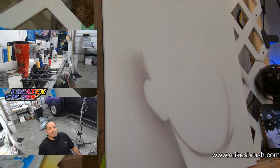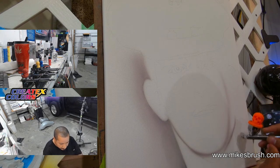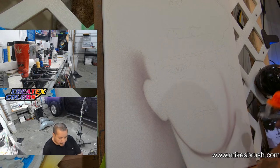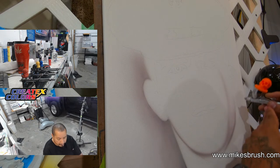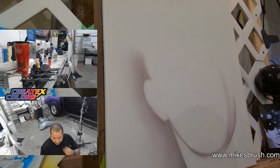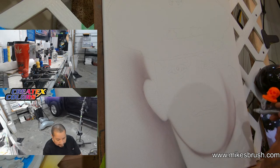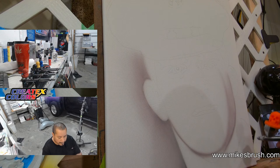When you paint plastic parts, do you use an adhesion promoter, and what kind? It really depends on the particular project. Most plastic projects, I do not use an adhesion promoter. I just make sure to clean everything off really well. I've learned a lot from painting on plastics, so I always try to find the plastic number on it somewhere. Certain plastics you can degrease in certain ways that you can't with others, and knowing that has helped me get paint to stick.